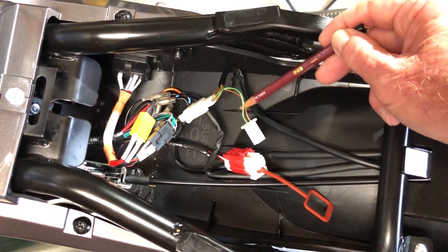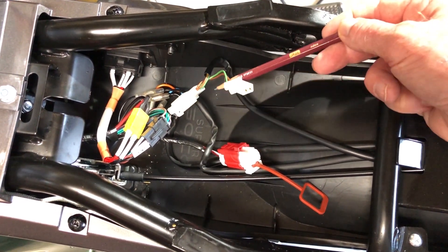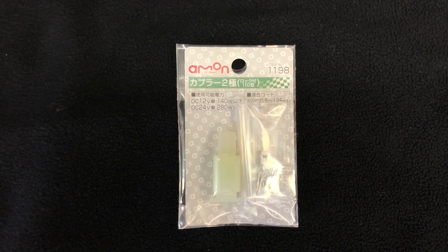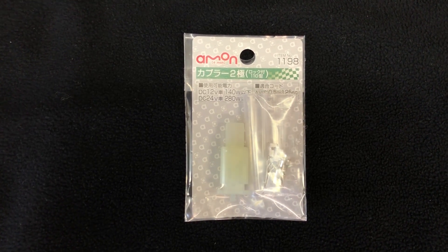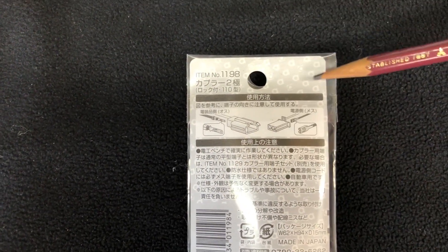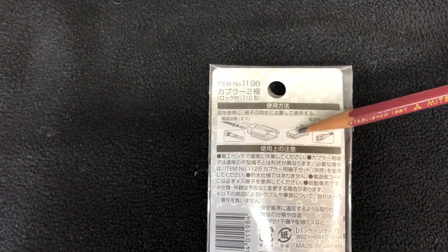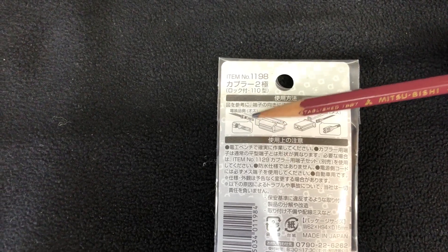We're going to put a little buck converter that converts the 12 volts into 5 volts DC for charging, and also we're going to make up a little plug that goes onto this socket. This is the plug adapter that I bought — I got it from Amazon, actually made in Japan from Amazon Japan, but I'm sure you can get one from Amazon in your local area. I'll put the details in the description below. We're only using half the connector. This one is already on the Super SoCo, so this is the connector we'll be putting on that plugs into the plus and minus connector of the Super SoCo, and this then will go to the buck converter from 12 volts to 5 volts USB adapter.